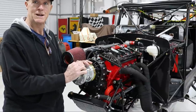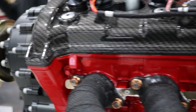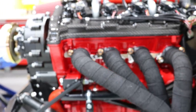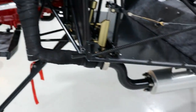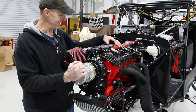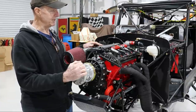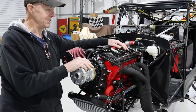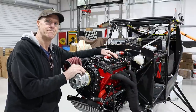It is a 150 horsepower Yamaha Apex 2006 with a Skytrex gearbox — what a nice piece of machined art that is. I carbon-dipped the rocker covers and made a custom fuel injection cover to hide all the ugliness underneath — the injectors, the wiring. I also made a custom air filter intake system, as well as all the hoses, radiator mounts, and oil tank. There's not too much on this engine I haven't touched, though I didn't open the block.